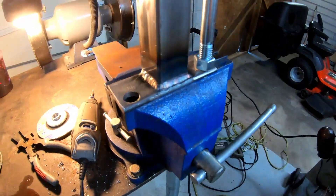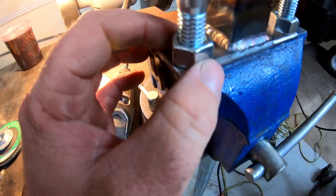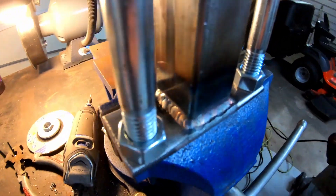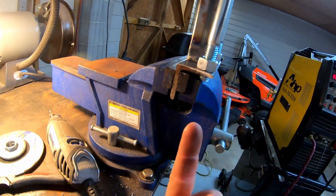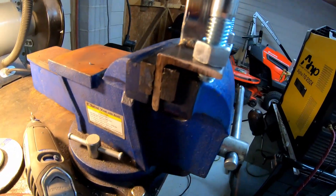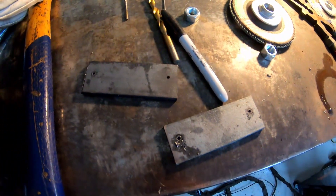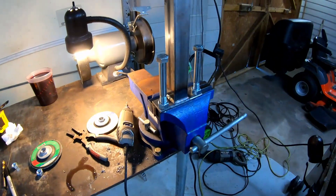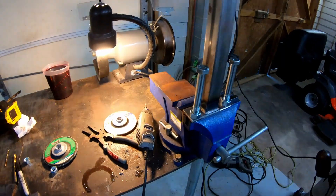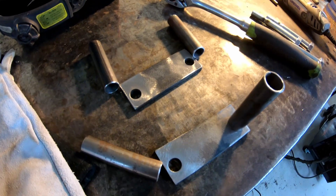Holes are there. Getting everything centered up, right on the inside of the rail, so I can put the bolt through the outside to the inside of the rail — I won't have to hold a nut or anything. I'm just going to tack those into place. Other side is ready to go, and I've already got the pilot holes on the other one. I'm letting the drill battery charge. While it's charging, I'm going to go ahead and tack these in place. These are going to be the anti-crush plates.